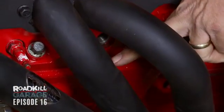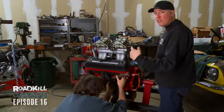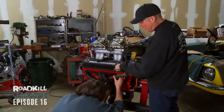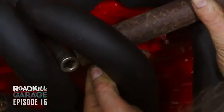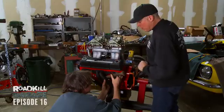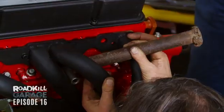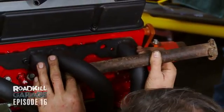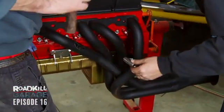So we've already made it nice and concave so that the boot will go on. We'd like a little bit more clearance for a socket so we can actually get the plug in and out easily. So we've got a 5/8 socket slipped just over the plug to hold it concentric, and the round part of that socket is now going to be bashing the header when I whack this right here. Ready? Yeah. Ooh. More whackage? No. You just drove into Golden Spike. Wow.